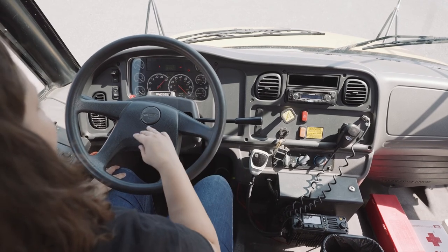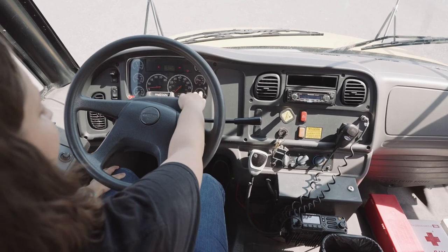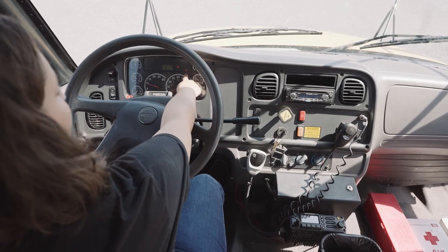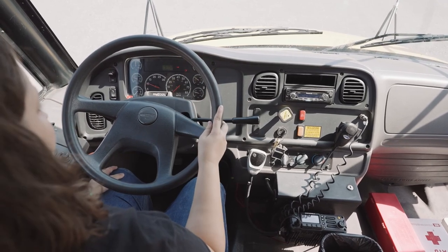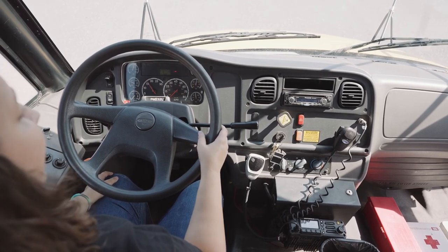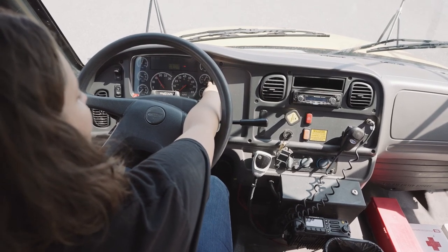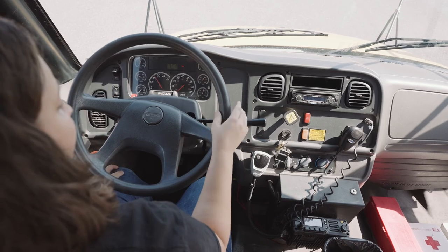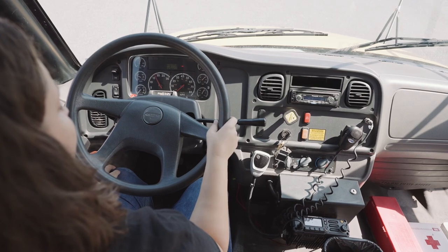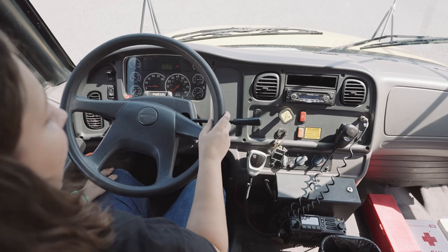The needles are safe sweeping. And I'm going to push on my RPMs to let that air build a bit quicker. But around 60 PSI, my warning light and buzzer will go back off. Which it did. And at 120 to 125 PSI, my air will cut off. Which it did. I will now be doing the high hold test.